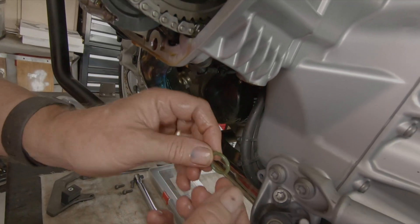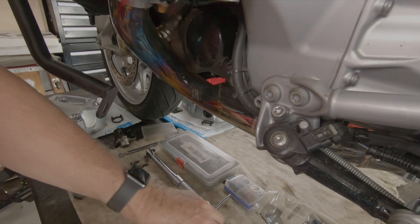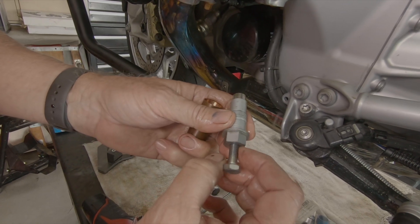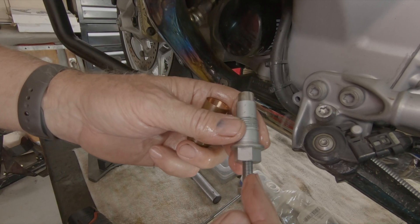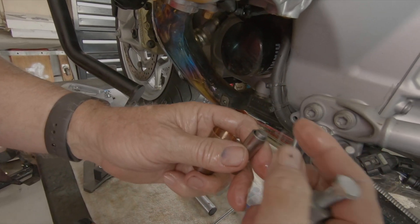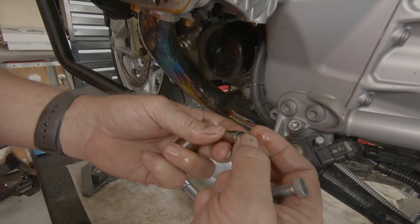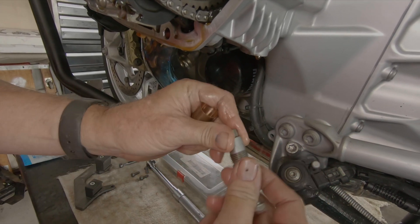The O-ring is a common O-ring used on lots of BMW automobiles for sensors that go through valve covers. We'll replace it with a new one. I've got this tool that I make — it's an old cam chain tensioner that's been drilled and tapped with an M8 by one millimeter thread pitch, so every single revolution of the bolt advances the bolt one millimeter. The body has a little spacer and a special spring — the brown color and length of this spring exactly replicates the force that the OEM cam chain tensioner provides.